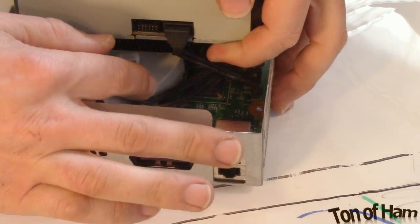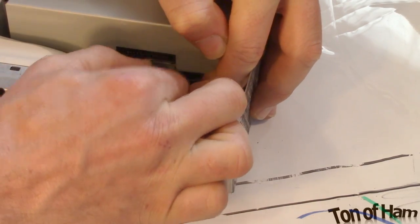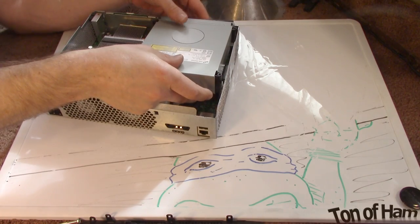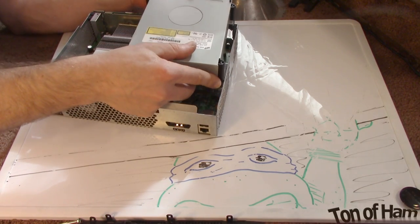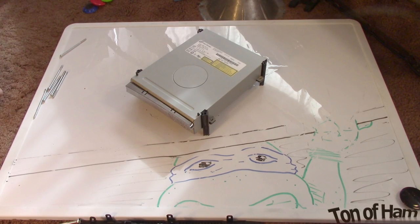The cables are pretty short so you can't pull the drive up too far — you might need smaller fingers. Now that those cables are out, just lift the drive out evenly — there are some plastic pegs — and it's free. To keep these videos from being too long, I'm going to break this down. You can go to the next part to look at the magnet problem, or go to part three for the full drive replacement if you have a new drive and you're just looking to put it in. See you soon.